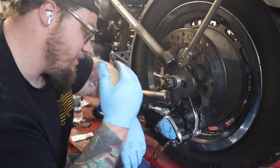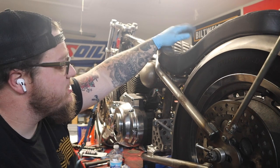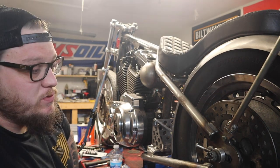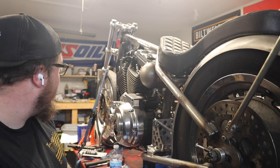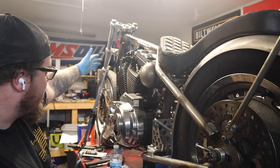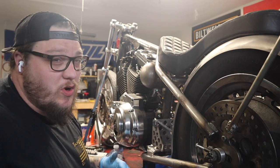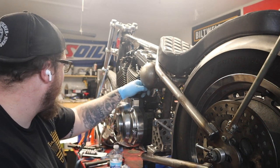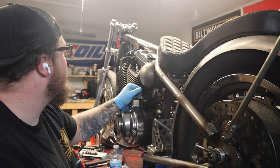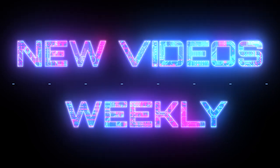I'm just happy I finally have a mounted brake caliper on this bike — big relief. The next big thing is getting the gas tank mounted, and once that's mocked and finalized, I'll clean up all the welds with my burr tools, pull the engine back out, and then this thing will be good to go to powder coat — which I'm excited about, because once it comes back I'm going to paint the tins. Then we can start finalizing everything as far as electrics and the front end. I did buy the TC Bros plus-8-inch front end, so this thing's going to have a pretty mean stance, and I also got a 21-inch wheel from a friend. Still not 100% sure if it'll work — don't know what it came off of, so that's a shot in the dark. And of course the engine rebuild still has to happen — check torque specs, make sure everything's tight. Things are coming together.